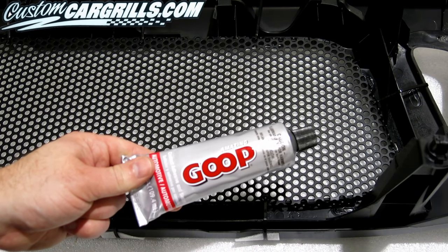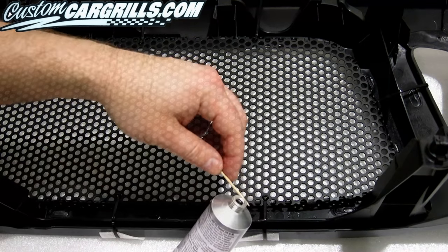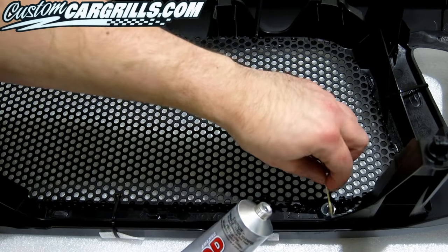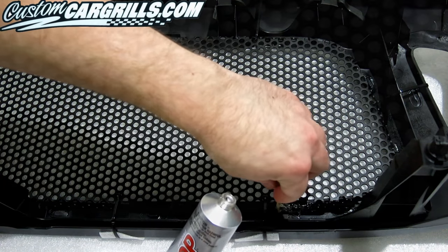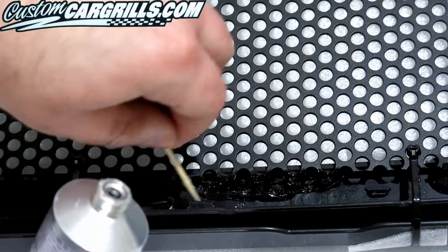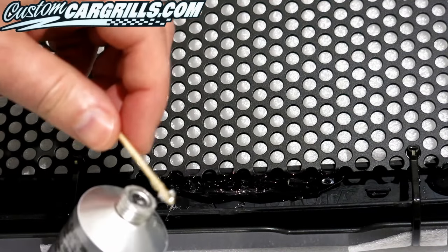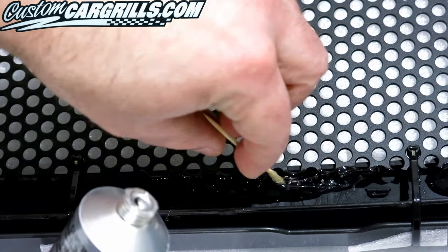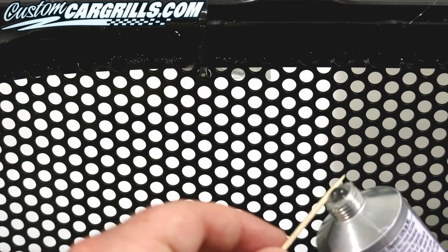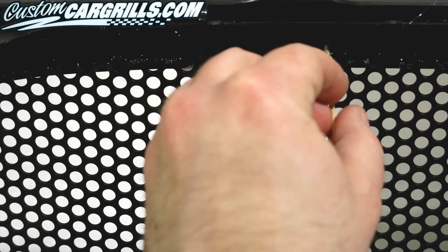Here's what everything should look like from the front. The mesh is firmly in place and the painted part of the grill assembly is protected with foam. Like with many of my other installs, I like using the adhesive called automotive goop. To apply the adhesive, I'm squeezing a medium-sized dollop of the goop onto a toothpick and quickly spreading it onto the pre-bent tabs. A fair amount of adhesive should be applied to these tabs since it's the majority of the holding power for the overall installation. It's important to move quickly during this step. If the goop is too runny, propping the grill up vertically as shown here might be needed, but caution needs to be used so that it doesn't drip onto the mesh.